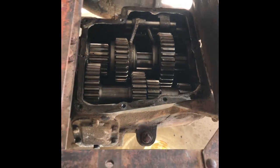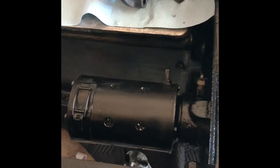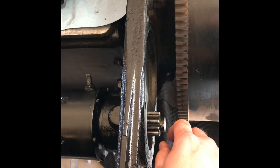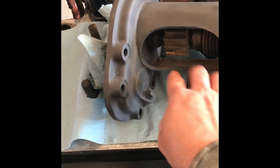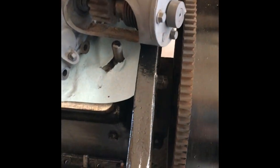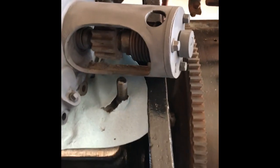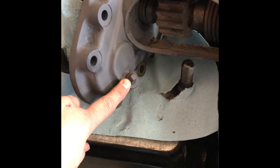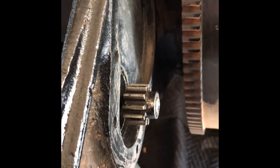The other thing I've been working on is I pushed the starter in — it had been rebuilt but it was a really tight fit, so I was using a soft mallet to kind of push it in, and then I noticed it's got a little grind to it. I hope that's normal, so I'm gonna put some power to it and make sure it's okay. It's interesting because it's really just a motor with a gear, and the rest of the starting mechanism is separate — like the bendix, which is what grabs onto the flywheel to start the motor. I found the nuts and bolts for that, got to clean those up. I put some primer on it, and I found it interesting — there's a little port to put oil, but it wasn't full of oil when I pulled it apart, so maybe that's just an inspection port.